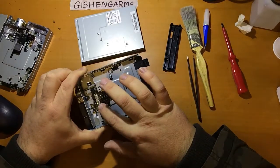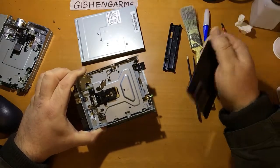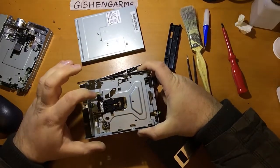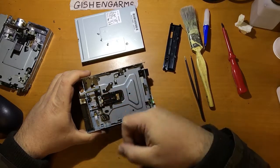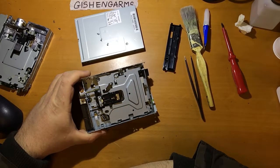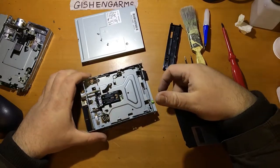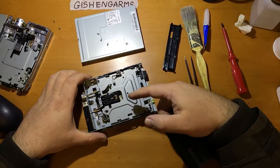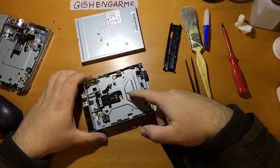And as soon as you start trying to do copies and stuff with this open and attached to the machine, you'll notice where things are skipping over. You'll notice if this shaft is turning and this isn't moving along it properly and it needs to be lubricated properly. You'll notice clicks and whirs which seem out of place. You'll notice if the heads try and go forward and then jump back, if they seem to be stuck at a certain point.